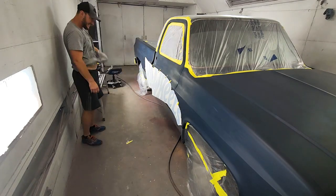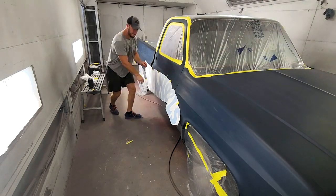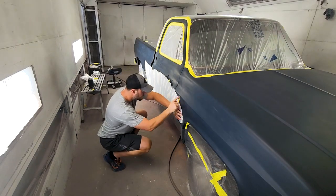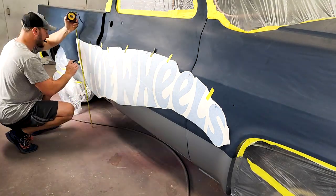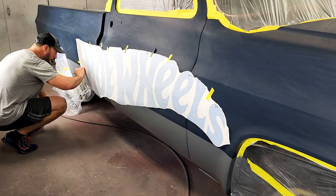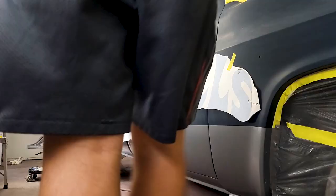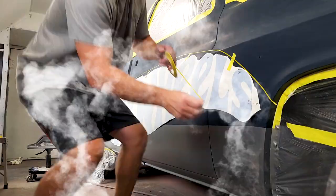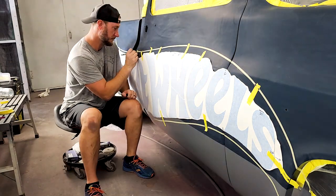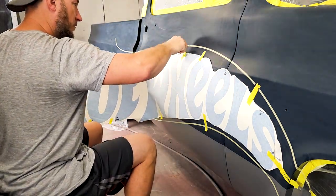My next step is I need to figure out the shape and proportion of my flame. So instead of sticking the stencil on, I'm just going to tape it down kind of like a dry run to get it proportional on the other side so it's lined up in the same relative position. I took a few measurements from the fender wells and from the ground up so I could transfer that to the other side. So I could then lay out some fine line tape that'll make up our flamey flaggy flame. Another thing I've learned through the years is to put registration marks on my tape so that after I paint it, I can put it back in exactly the same position.